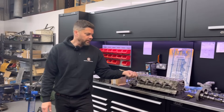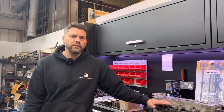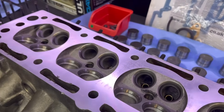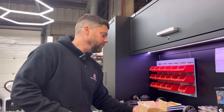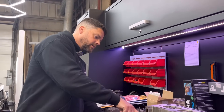This one over here - I've got the bottom end together and it's looking good. I'm just about to sort the head. The head has all been gone through, he got it with the car, just told me to strip it, check it, clean it and make sure it's been done. It has got new guides, the seats have been cut and lapped, and the head's been faced - I haven't even got to do that. But this is a reason why you should remove all the gallery plugs and check - because if they were going to chuck this on...